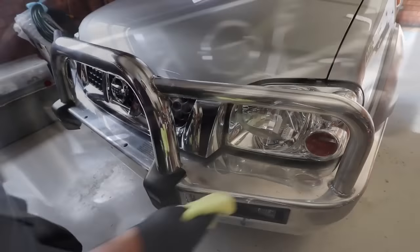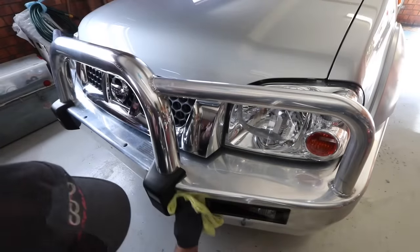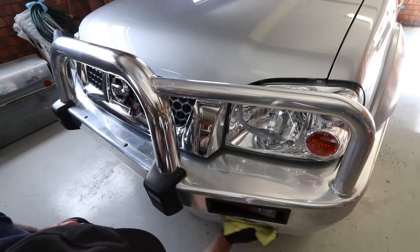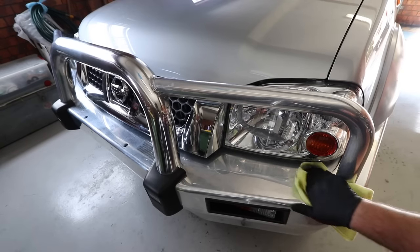Personally, I prefer to use microfiber pads to apply the metal polish, as I find they work a little better than foam pads. Also, I use some of my cheaper microfiber cloths to remove the residue, and more often than not, I'll just throw them out after the job. Sometimes the metal residue can be really hard to wipe off and remove. In those instances, I'll spray on some waterless wash to help and aid with the removing of the stubborn residue. And don't be afraid of using the applicator pads that instantly turn black when metal polishing. It's just the way it goes with this medium.